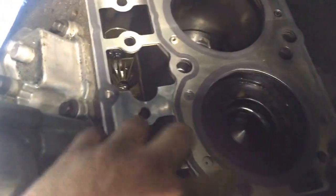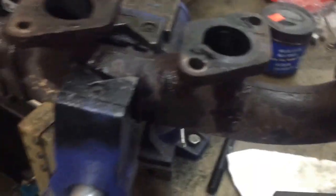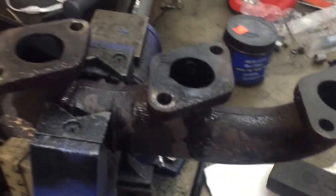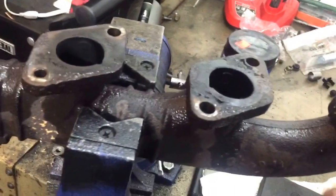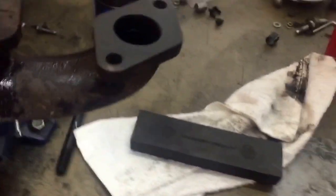There's no swirls or anything from using a 3M disc, and it's less messy. It's easier to control. With the big stoning block, it makes it really nice to clean stuff up. When I stone a head or any engine block and I don't want to ruin the metal or put scars into it that could cause leaking, I just take some WD-40 or any type of lubricant.